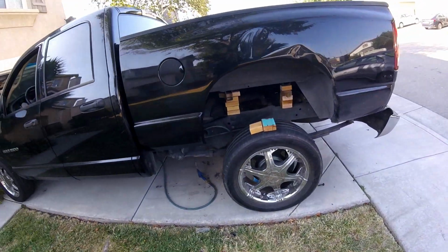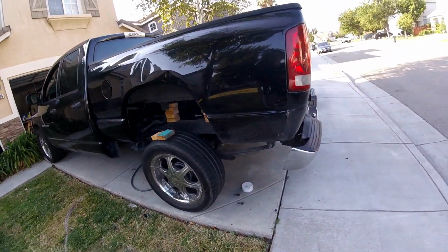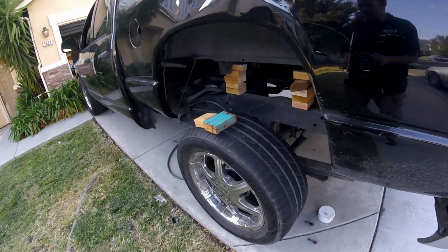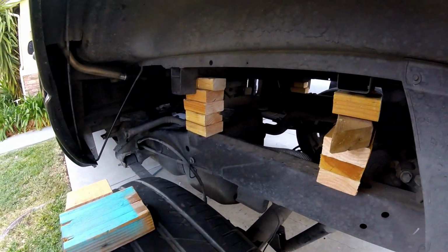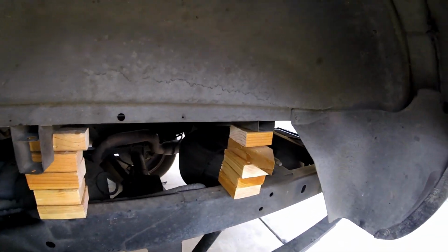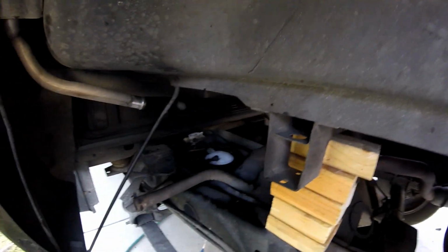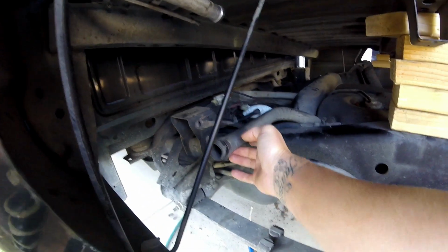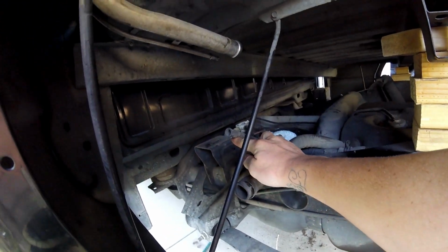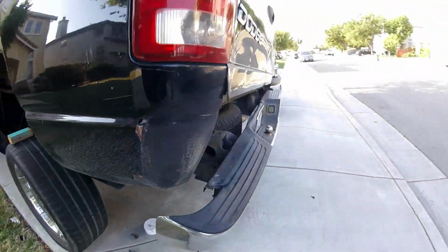You have stumbled upon part 4 of my fuel pump assembly replacement on this 2004 Dodge Ram. Covers many engine sizes and models. Right here, these are the hoses that need to be reconnected when the bed gets lowered back down to its normal position. All these blocks need to be taken out. The filler neck and the breather hose that's right next to it both need to be connected. I would recommend replacing the hose clamp on the filler neck hose at this time as well.